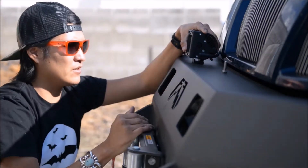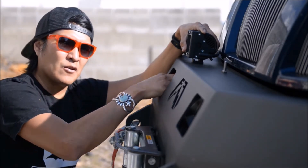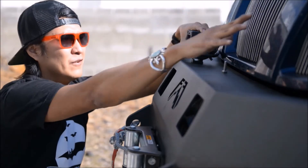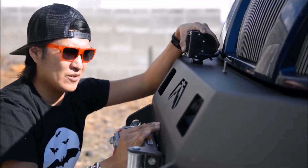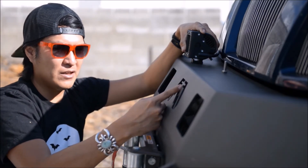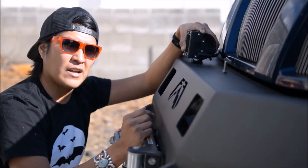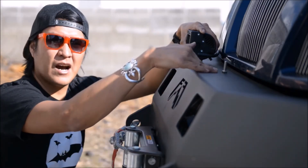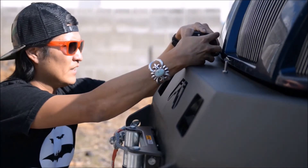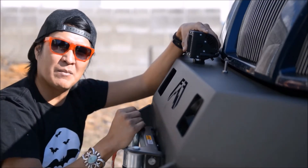Some things you may want to take into account are objects that may get in the way underneath. To measure my center line of the bumper, I tried the front fascia right here but that's kind of crooked. So what I did was go to the center of the bumper — right here on the Fab Fours bumper, the middle of the logo: from this peak to the inlet is the exact same measurement as from this other peak to the inlet. So in a second I'm going to show you a tool I used to transfer that measurement up to the top to help find my center line going left to right. That's pretty much what I'm doing right now — finding a good fit forward and backward for the brackets, then I'll mark it out and make my pre-drill.